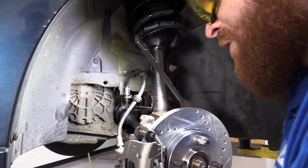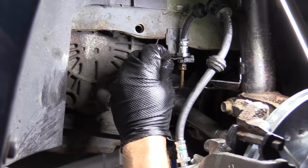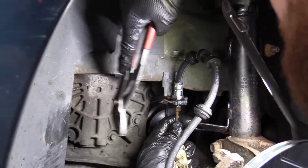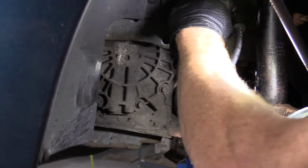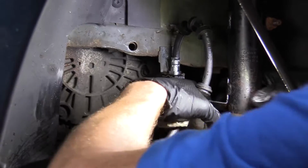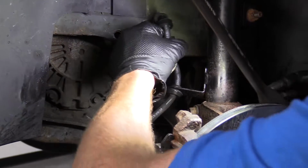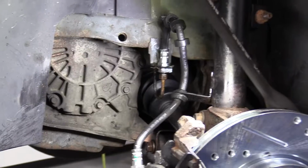At this point, we're not in much of a rush. Say we're clean enough. We've got our clip. This just slides right in, and it's going to sit in that slot that I showed you before. You can give it a couple bonks. It's nice and locked in. That line's not going anywhere. We'll take our hose. Just going to bring it over. It's going to slide right into this bracket right there. There we are. Now we're clear to pump up the brakes and bleed out the caliper.